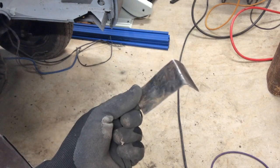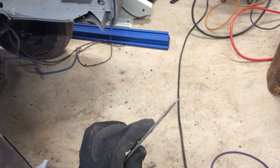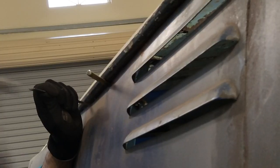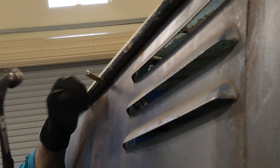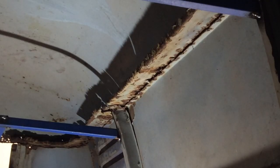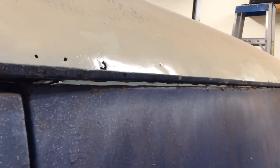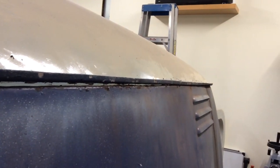There are more of these brass welds on this side of the van, which are more difficult to deal with than the spot welds. I was using a piece of sheet metal as my chisel to work through the spot welds, but this kept bending. So I found an old thin file and modified it, and this serves much better as a chisel. So this is how much I achieved for part one of the roof repair, maybe just under a quarter.